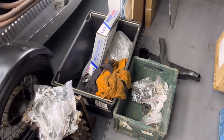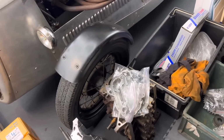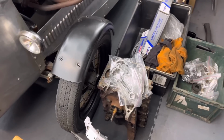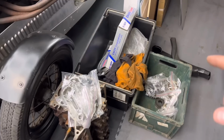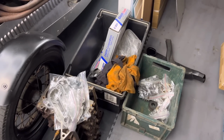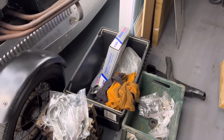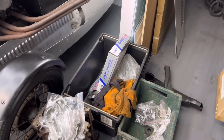Okay, so we got a little job down here that came in a week or two back. We've been meaning to get to it, but obviously we've had a few things to clear up. So this is a Mazda MX-5, a 2002, and it's in for, I believe, a rebore and face the block. It's got the crank assembly, which needs to be balanced, etc. Isaac's got that round on the crank balancer at the moment, but the customer looks like he's had a go at knife edging it from watching one of our videos, apparently.